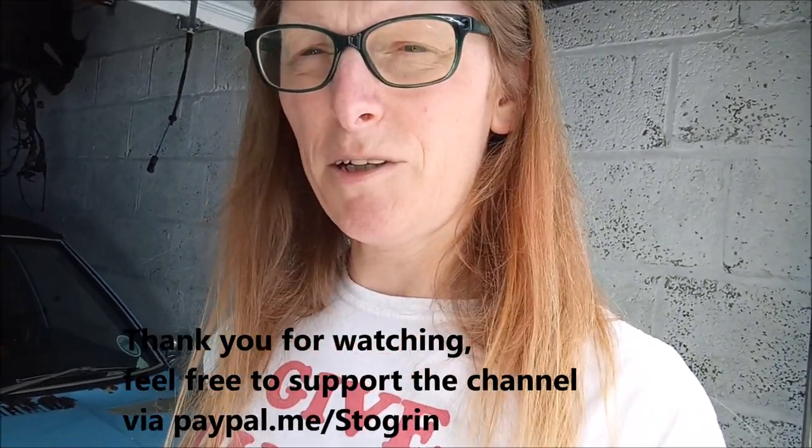So the next part of the fact-finding extravaganza, shall I call it, is going to be jacking up the back end of the car, putting it on jack stands, starting the engine up, running it, and seeing what squeaks and rattles. But I might need a second human to help with that, because I need to control the car. I can't just let it... well, I suppose I could, but I don't like doing that. So if I can control the car with the throttle and the clutch pedal, I'm thinking bike still, because clutch levers are on bikes. Just lift the clutch so the prop moves, and then you can hear the rubber squealing. So yeah, I don't know who's going to be able to help me do that, but I'll figure it out somehow.